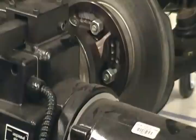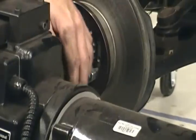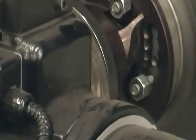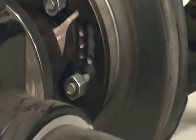That's our calibration plate. As soon as we get this thing connected and ready to go, we're going to calibrate it to the car. We'll use this plate for that. On this plate, it's got two shoulders on it that makes it fit down in between these two flat plates. Make sure that the two flat slides are lined up and it will not twist.